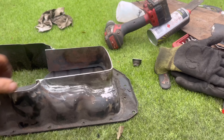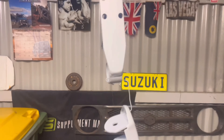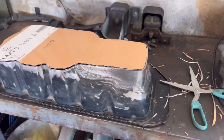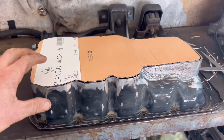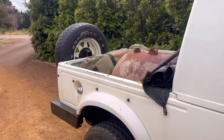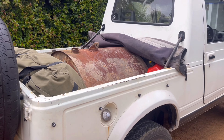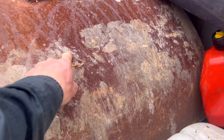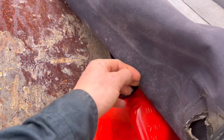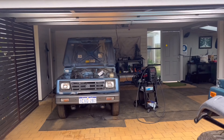Tough welding this oily stuff. I did a bit of shopping — because I live in the country there's not much choice of steel. I got this plate; I'm glad I took the ute because it only just fit width-wise in the tray. It's about 2.5mm plate and I only need a section like this, so I can flatten that out with the hammer. I also bought some diesel so I can check the sump for leaks overnight once I've got that plate welded up.